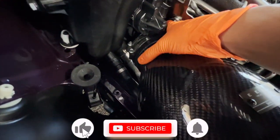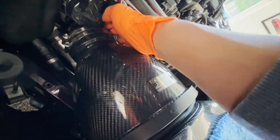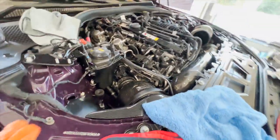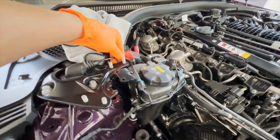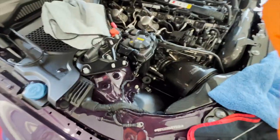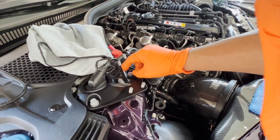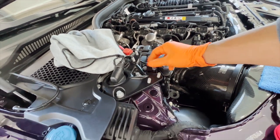What I'm going to do right now is pull this hose right over the intake. Make sure it's evenly done on every single side. Once you get that done, re-secure the cooling expansion tank — make sure the little peg goes into place. Also make sure the wire goes underneath the support bracket. You'll hear it slide and click into place. We'll get our two 10mm bolts and re-secure the expansion tank.